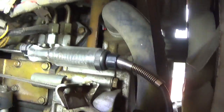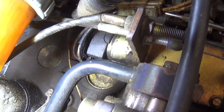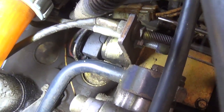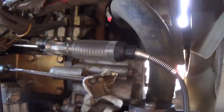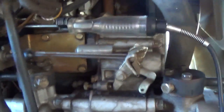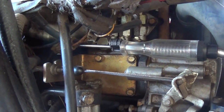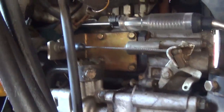You can see there are lines that feed fuel to the three cylinders, and there's our coil. So when you're cranking or running, that should not be energized. The first thing I did was put a test light to ground and turn the key on — our test light is lit. When we crank it, it's still lit. So I don't think that's supposed to be on right now. The easiest way to check is to unplug the coil and see if this thing fires up.